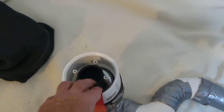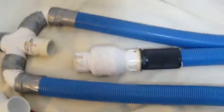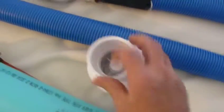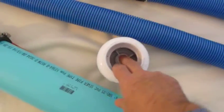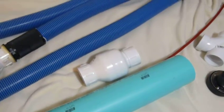The exhaust from the two parallel vacs will blow out here and it will be restricted by the check valve. So your back-end motor should be fine and it will still work even though this check valve takes a lot of pressure to open it. You have to have three-stage vacuum motors or something that has over a hundred inches of water lift — I don't think it will pull that device open.